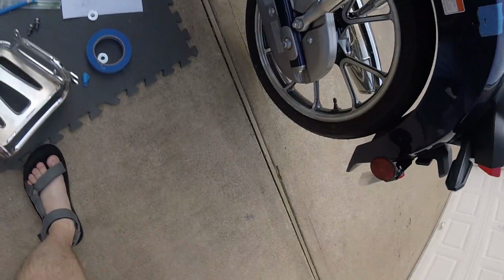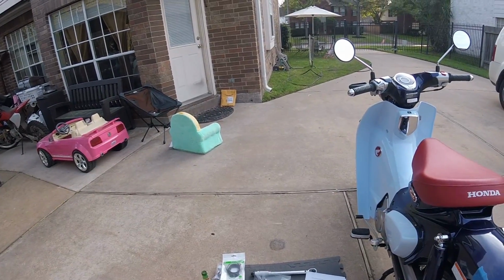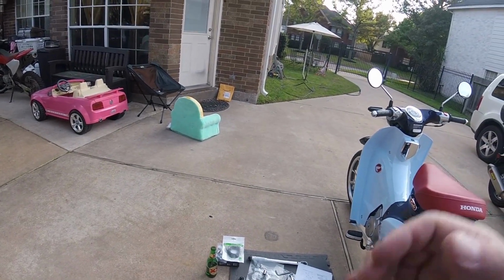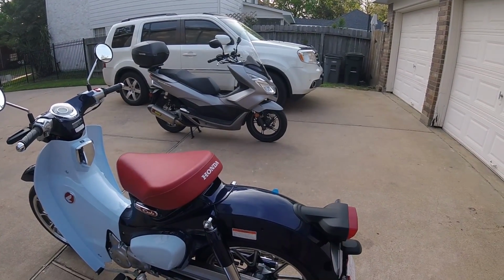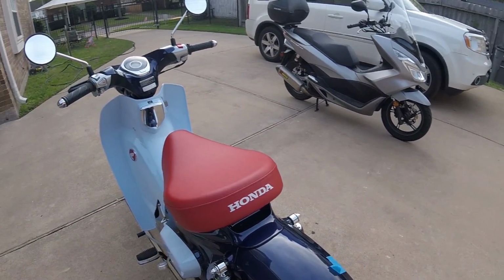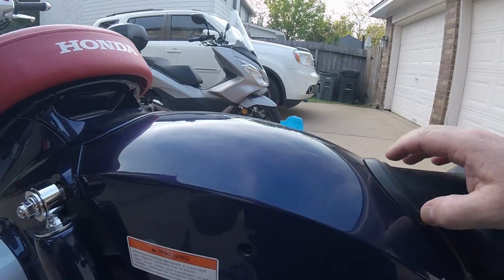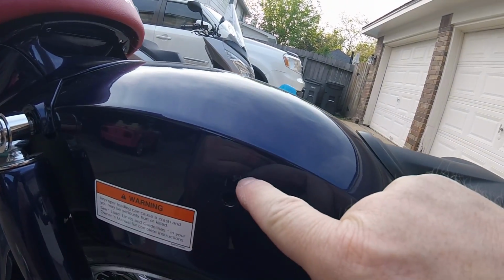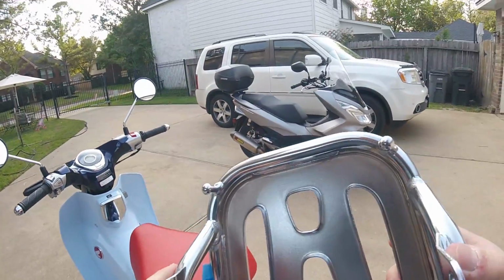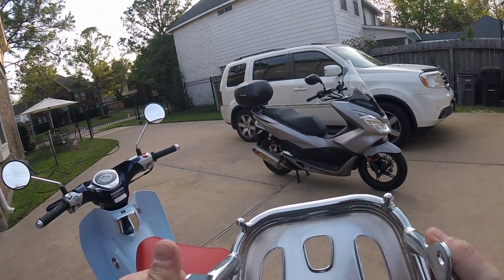All right, another intermission. I'm gonna take it into the garage and vise it and just tweak it out a little bit. It's a bad welding jig that they've got there. It got it too close. So for anybody putting the rack on theirs at home, be real careful. I'm being super cautious with my new toy here, and that rack is not welded correctly. The angles are off on the back, and you can see I've already cut my paint here and all over here, and I was using painter's tape, so that just goes to show how tight and sharp these edges are. And this whole thing is plated, so I don't really want to go filing and sanding on it.